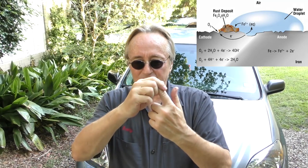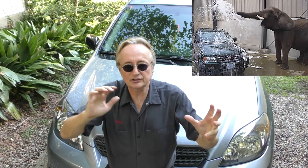He towed it in and I stripped all the paint off. Remember, rust is created by iron and oxygen and water, and it's accelerated by salt, which makes it more electrically conductive. Just like people aging, you can try to slow it down but you can't stop it. Slow it down by keeping a good coating on steel and iron products. The absolute best preventative is to keep your car waxed without scratches, and rinse it at least once a week. Salt water can pool in all kinds of parts, so do a serious rinse — go to a car wash with a wand and rinse everything including all the drains. Or you could just move to Phoenix, Arizona, where it hardly ever rains, there's no salt, and it's dry as can be.